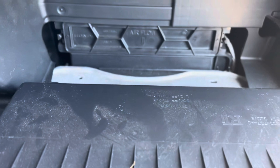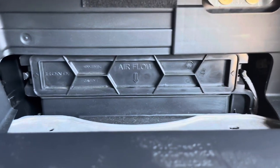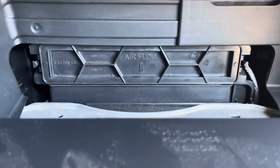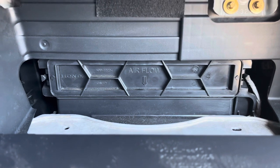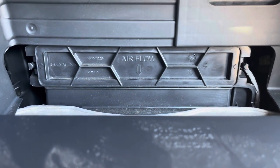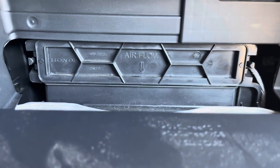So now if you're getting a weird smell through your AC vents, that could be part of it, or you're just not getting a lot of airflow. This is for your air conditioner vents — this is not for your engine air filter. This again is for your climate control. So if you're smelling some funky smells, or as you see, mine's only got 20,000 miles on the car and you saw how dirty it is — you can get those changed out pretty quick.